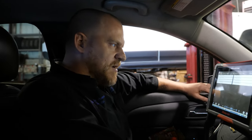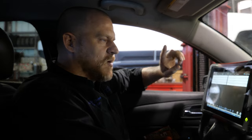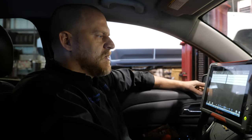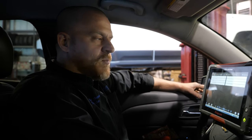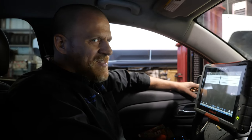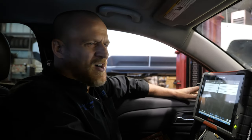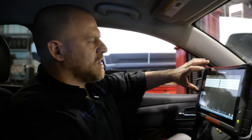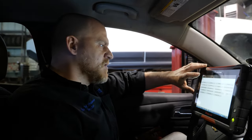So the recommendation there is one coil, all 4 plugs. Warn the customer of the other coils. I'm not saying to sell all the coils at once. It doesn't need them all. If this is my car, I'm putting one coil in it, 4 plugs. The car's got 200,000 miles on it. And suggesting the other coils is not a bad idea from that standpoint, but that'd be a suggestion, not a need. There's a difference. Talk to your customer, let them know where you are. All right, that settles that part for me. Sorry I couldn't get the secondary waveform. You guys know what I'm talking about.